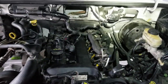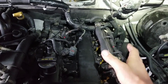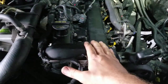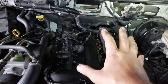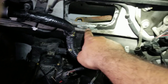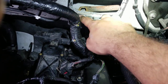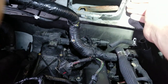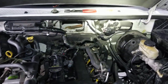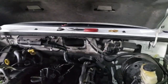For your information, you do not have to remove the intake manifold. I removed it because I did the valve cover gaskets and spark plugs. For this job there are just three 5.5-millimeter screws — there's a cover, the cover has a gasket seal, and you just pry it up, pop it out, and you're good to go.